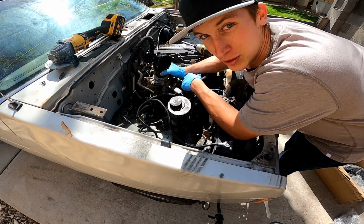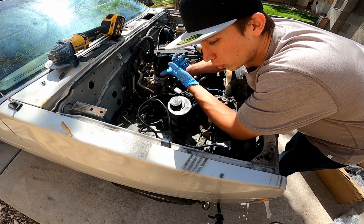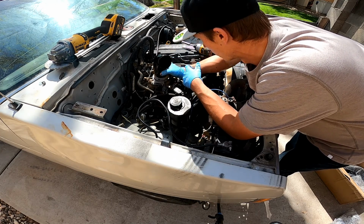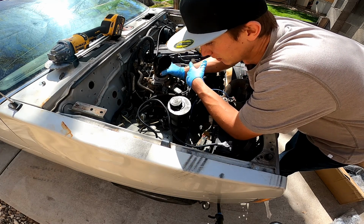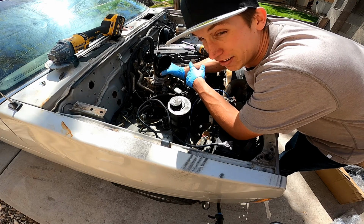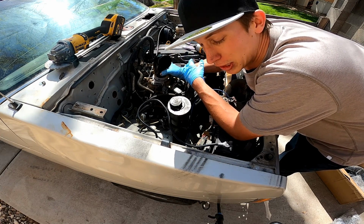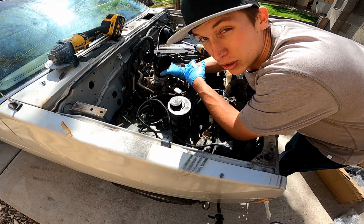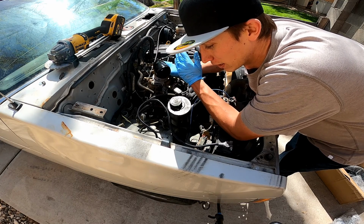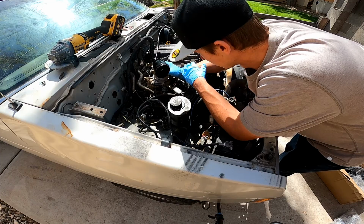I just don't want to put a 240 plenum on there. If you put the 240 plenum, you have more top end, but with the truck manifold, you have more torque. And I'm a fan of both. But I do need like 370cc injectors, or like 400 or 500 to get that 300 mark. I'm thinking at least a 400cc to have a little bit of headroom for the computer to adjust it a little bit.